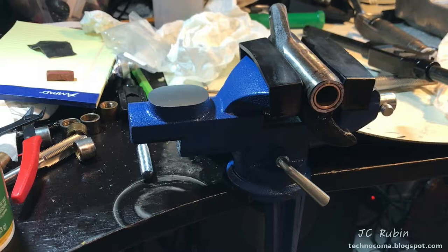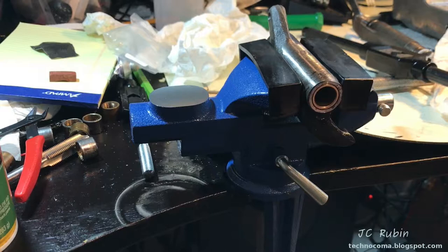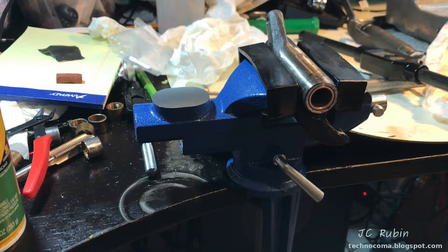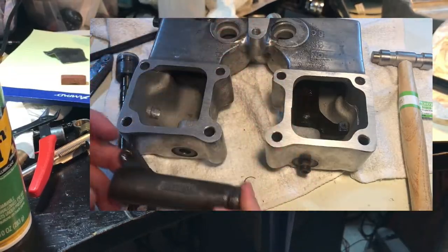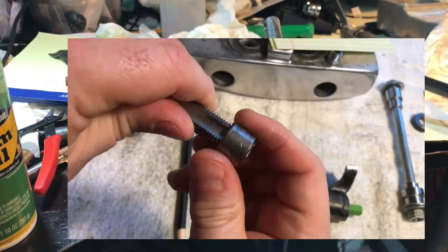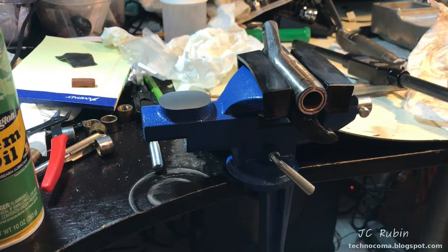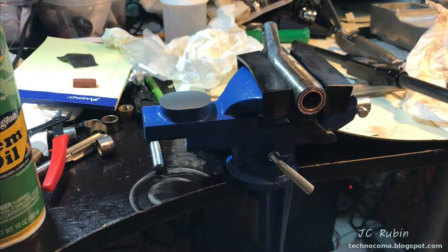Welcome to part 21 in this FXS Low Rider restoration series. If you're first joining us, click the link in the top right corner for a listing of all the videos. This continues from our last video — a rejuvenation of the rocker boxes. The bushings were found during disassembly to need replacement, were removed from the rocker arms, and new bushings were pressed in with a special tool. We'll continue now with the second half of this operation: reaming the bushings that have been installed into the rocker arms.